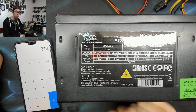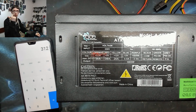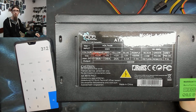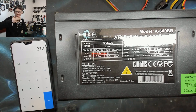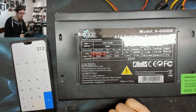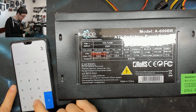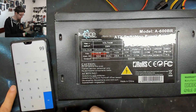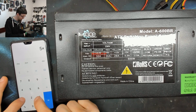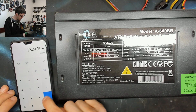That's really bad — that's half the total output. Although this is a 600W power supply, as far as your CPU, graphics card, and drives are concerned you can only use 300W, which is really low. So where is the rest of the power? The 600W is kind of there — if we run the numbers on the other rails: 3.3V × 30A = 99W, and 5V × 36A = 180W.